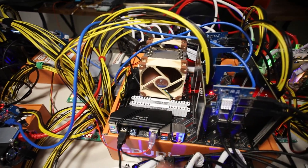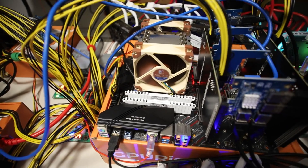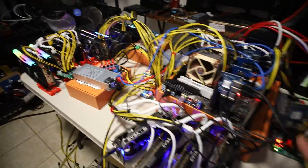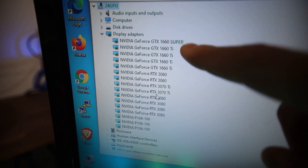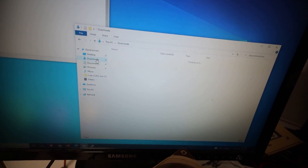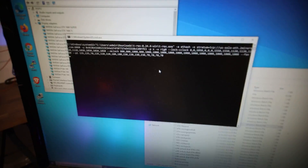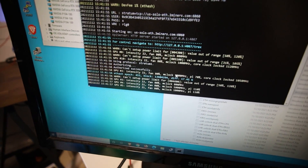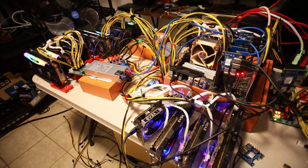I'm not giving up — I do want to see if I can get a higher processor than the 1900X, which only goes up to around 55-60 usable PCIe lanes once other hardware uses some. If I get a 3960X with 88 PCIe lanes or a 3990WX with 128, I wonder if that would give me the ability to expand more graphics cards on this rig. That would be incredible. But to verify for you all: we can see 16 GPUs in Windows — let me get it mining, because I think that's what you want to see.